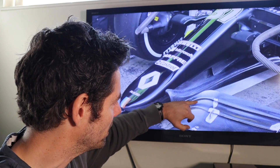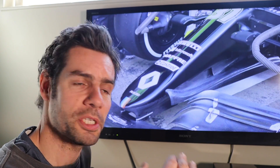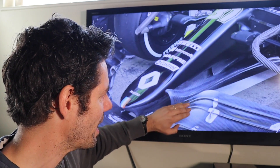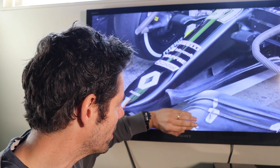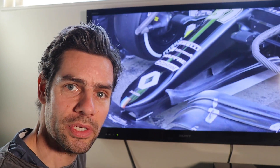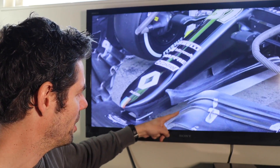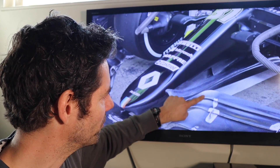The pressure going around the longer distance speeds up, the pressure lowers. That means there's a big pressure difference between the underside of each of these elements and the airflow passing over the top. When you get to the tips — the trailing edges — that airflow with the big pressure difference rolls over to spill into each other. So each wingtip creates a vortex where the flow spills over the edge and rolls over, forming a spiral of airflow. Each wingtip is carefully positioned so those vortices combine into one big, powerful vortex — the Y250 vortex — named because it's 250 millimetres from the Y axis, the centre section of the car.